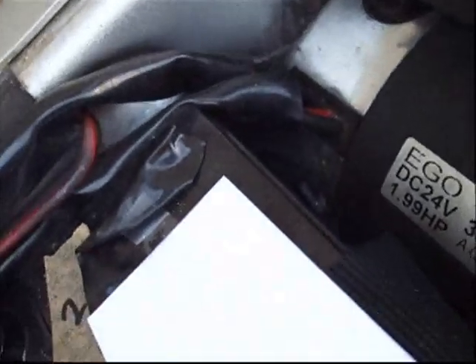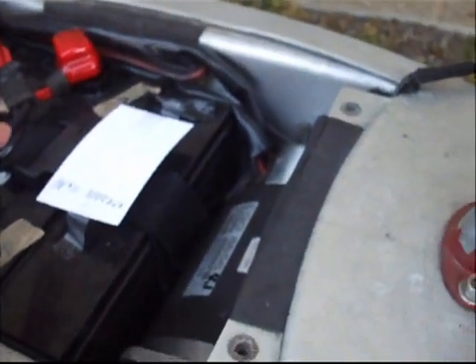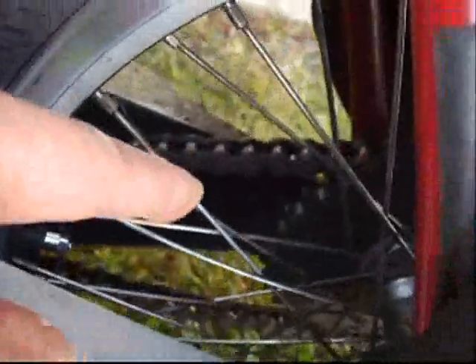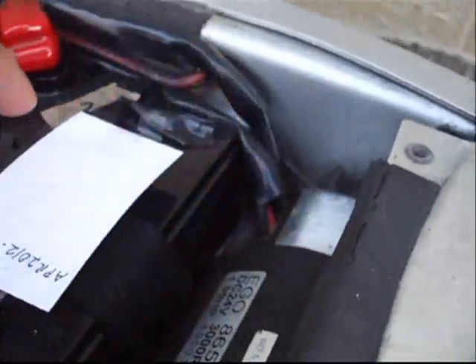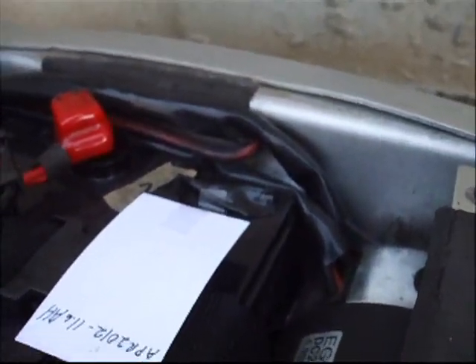I'm going to put this camera down there so you can see the auxiliary fan. Down there is also a mud shield, because one of the major flaws of this chassis design is that the chain drive — or the original belt drive — would throw mud into the chassis. The mud shield prevents mud thrown by the belt or chain drive from coming into the chassis. If it weren't for that, this motor would be covered in mud and dirt.